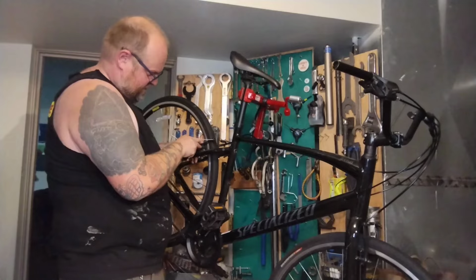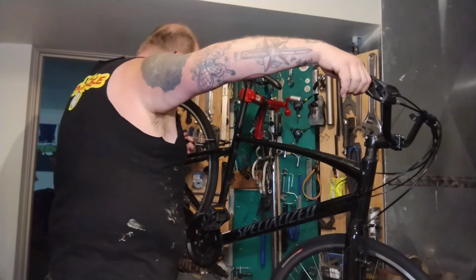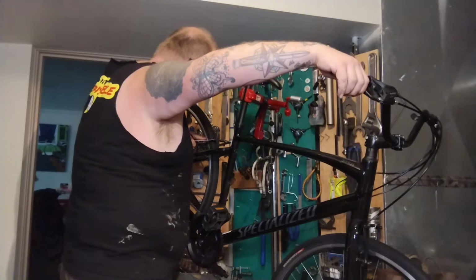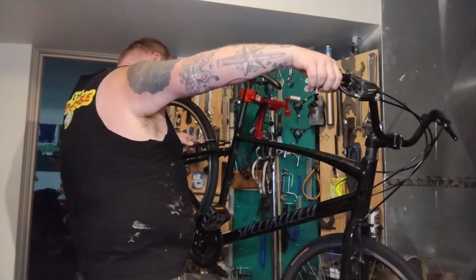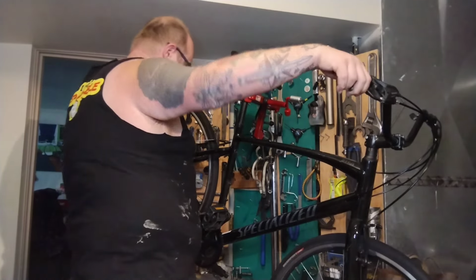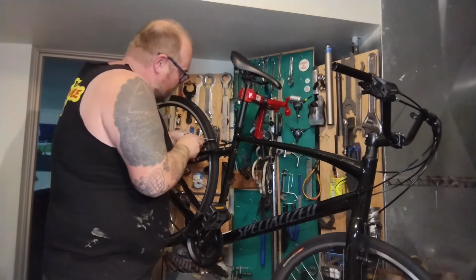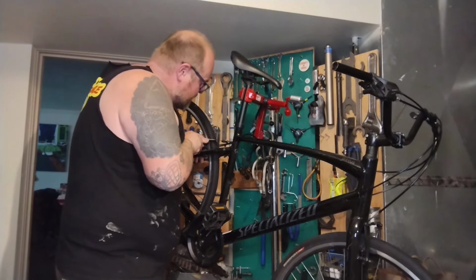The burr or something here is running back and forth to knock it out of the way. It's like being a jerk. It's like hitting a couple millimeters too high or too low, and you cannot be in the right spot. Little burrs trap you and make your bolts want to sit where the burr wants it to sit, not where you want it to sit.